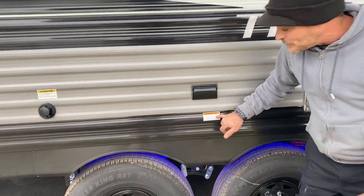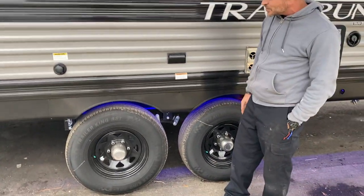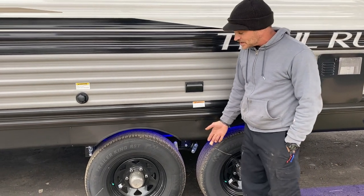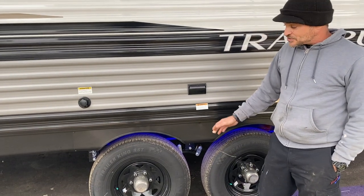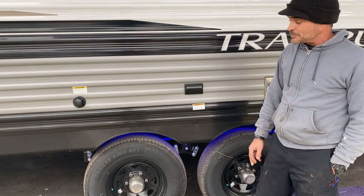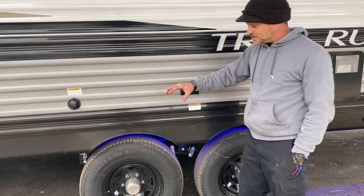Wheels and tires — if you happen to have a tire change, they want you to re-torque those lug nuts at certain intervals: at 50 miles, 100 miles, and at 200 miles. Your tire pressure — you have a maximum tire pressure set, but you need to go five pounds below it. Always make sure that your tire pressure is good before you load up and take off with the camper. If not, you'll wear the outside treads on the tires, and then you'll have a mohawk of tread on the center of the tires.